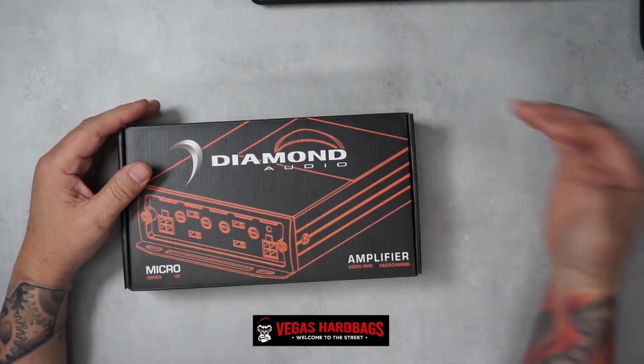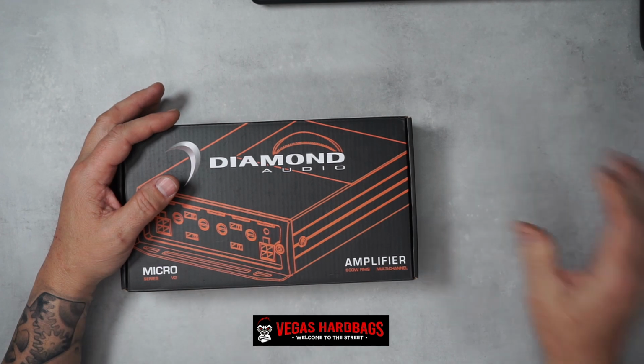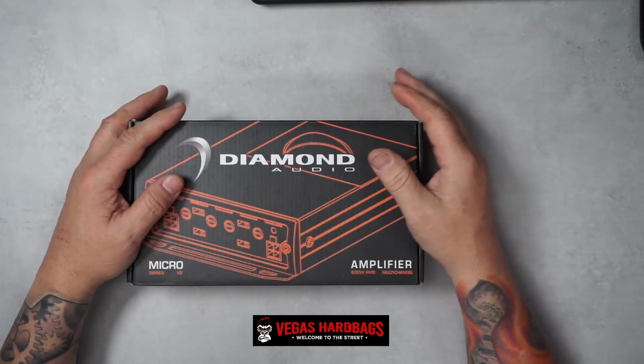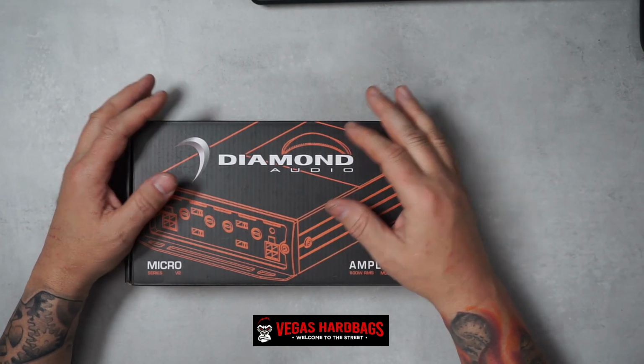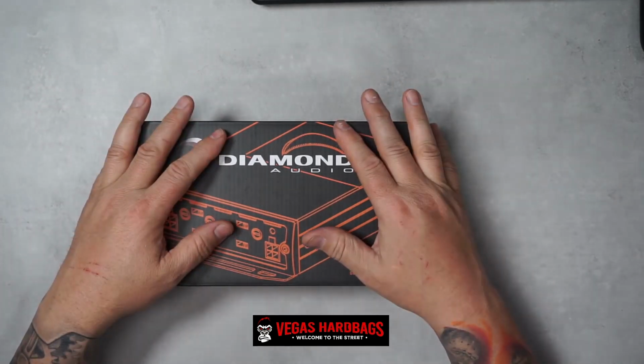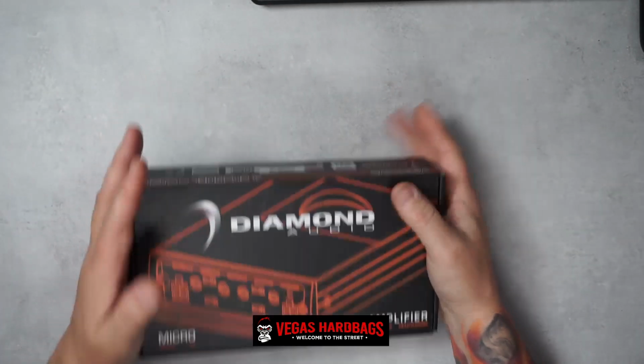I want to make sure that those horn drivers are going to get their 50 watts a piece, if I remember correctly, continuous power at all times to each one, and I want to make sure that the SX Neos get their 100 watts that it needs, continuous RMS value. That's going to make it cleaner and louder every time with no distortion, and that's what we're all about.